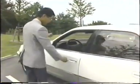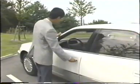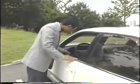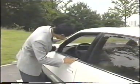The theft deterrent system is designed to discourage theft by sounding a horn and cutting the starter circuit. When all doors are closed and locked, either by the door key or the wireless door lock system, the indicator light goes on. After 30 seconds, the light begins flashing, indicating that the theft deterrent system is set. If someone opens a door without using the key, the horn sounds automatically, and the starter circuit is cut at the same time.